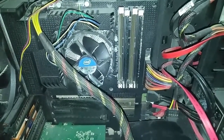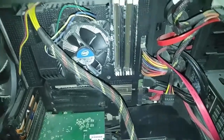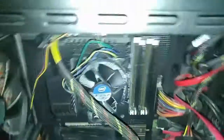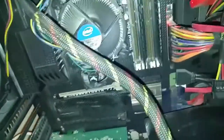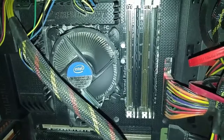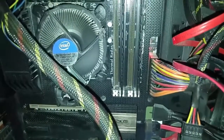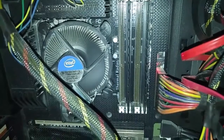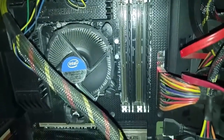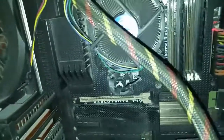Right now I have the RAM sticks out and it makes this noise when I start it up. It's trying to detect — one and two short beeps. There's an LED indicator right here that's supposed to be the POST check, to see if it passed or if there's an error. That's the error for the memory sticks, because there aren't any inserted right now, which makes sense.